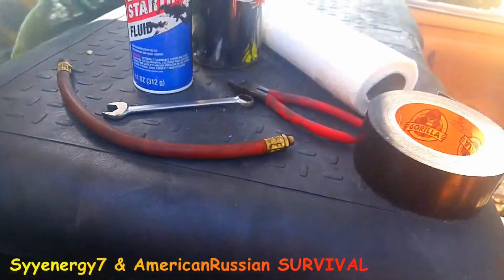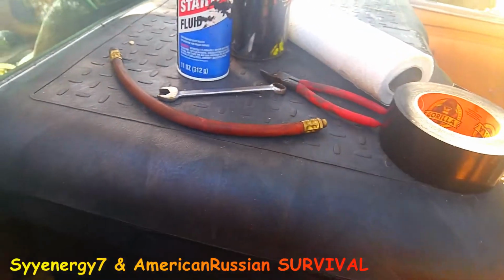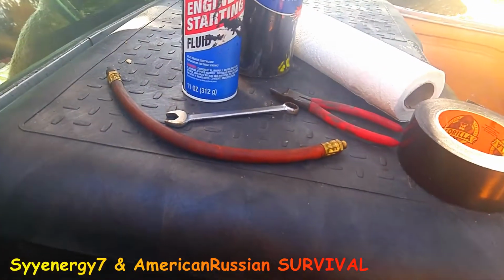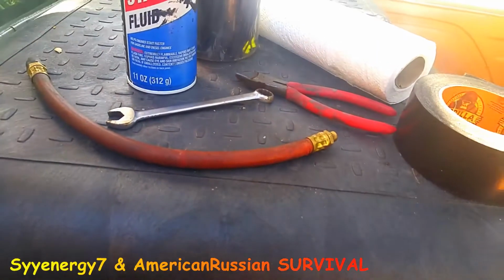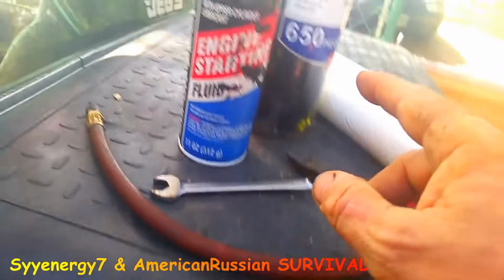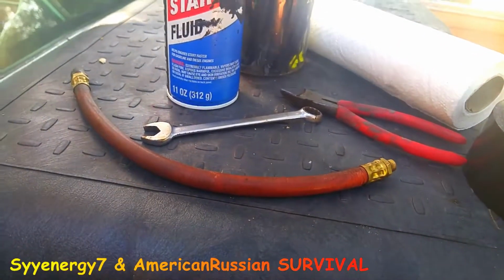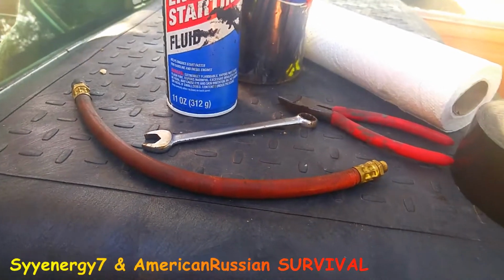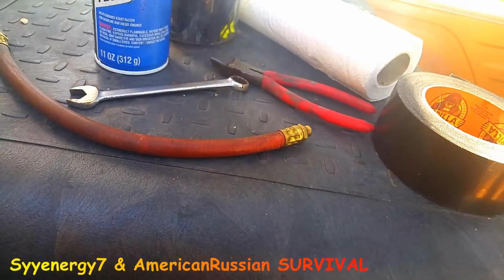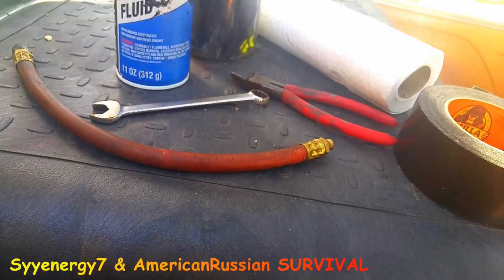But this is a fast, expedient, expeditious repair, if I'm using that word correctly. It'll even work for oil lines somewhat, because if you have enough of these cable ties as clamps, say you put a whole bunch of them almost right next to each other, the oil is not going to really infiltrate the tape where the glue is, because it's going to be clamped. And besides, you're putting a compression fitting on it.